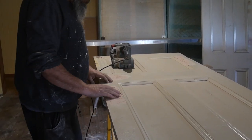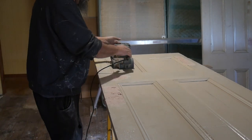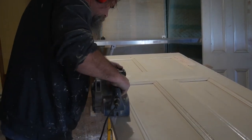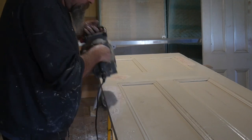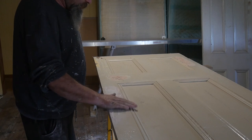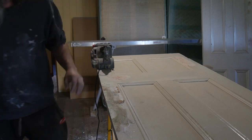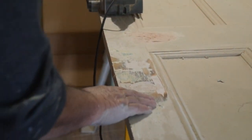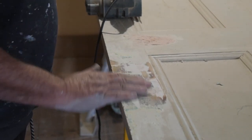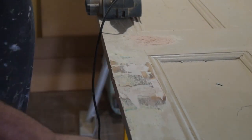The quickest way to get this bogged-up surface flat is with a belt sander. You can see a belt sander takes all the tops off and gets it down to a nice flat surface quite quickly. Taking that down, there's still some little divots in there but it won't take much bog — just one more coat and that will get it nice and smooth.